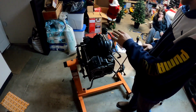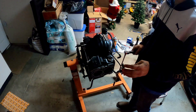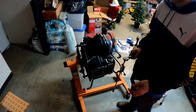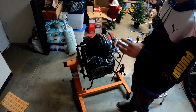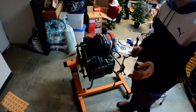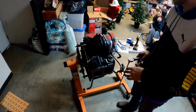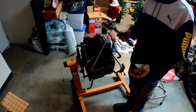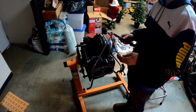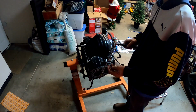Okay, so the torque spec for these bolts is not going to be ungodly tight, so don't go and crank them all down. You will end up breaking them. I've done it before. It's technically 4.7 foot-pounds for the 2.5 liter and the 3.6s. This is a 2.5 liter, so it's hard to get 5 foot-pounds to click on a foot-pound torque wrench or a 3/8 drive torque wrench.